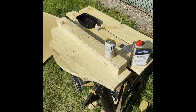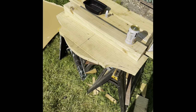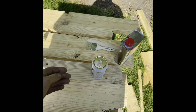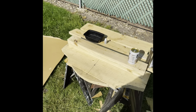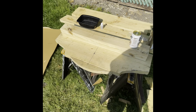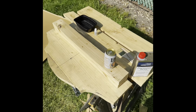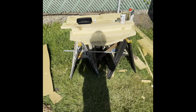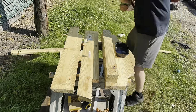And then tomorrow I'm gonna install it in the boat, and then I'll go ahead with some build-up putty. I'm gonna do all the seams with it so they're all nice and smooth and contoured, and then I'll apply a glass mat over everything, just so everything's fully waterproof. And then I might slap one coat of gel coat over everything just to give it a nice white finish, so you can see if there's any oil in the bilge or anything falling in and stuff like that. So I'm gonna have me a beer, mix up some stuff, and I'm gonna get to it.